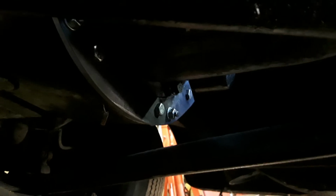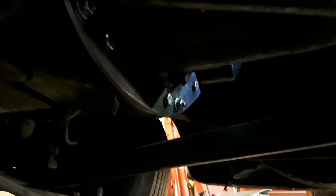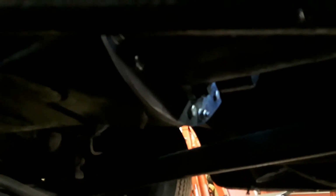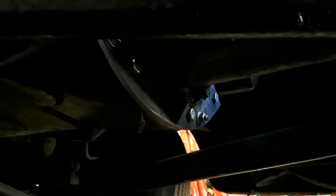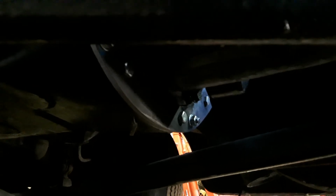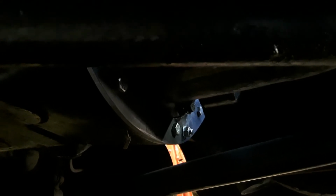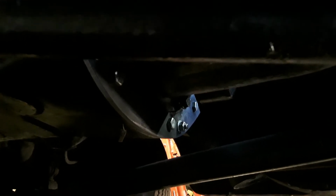You can see where I've made a steel plate, and inside there's a series of three tabs that are bolted inside of it to catch the three transmission bolts on this side and on the bottom, and that resolved the problem of stability. It took a bit of pattern making and some very careful calculation, but it fit perfectly when I put it in. But that's where we're at with that.